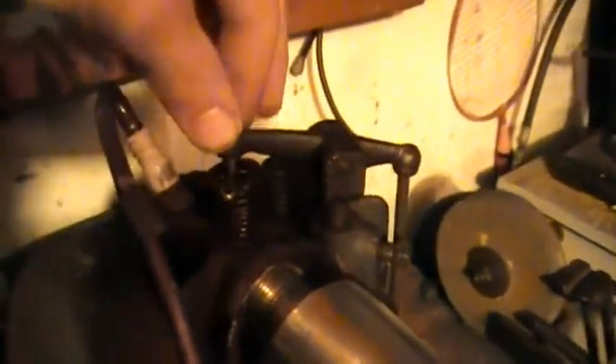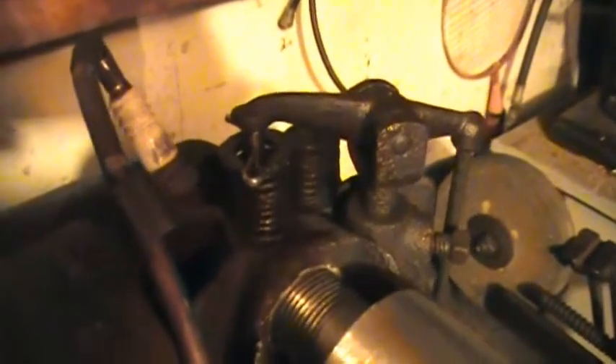So I'd rather the valve stuck than the piston. Anyway, the exhaust valve was a pain in the butt to get unstuck. I actually broke this — this valve came out of another Briggs 5S, I think, which works with the FH models. Anyway, the original valve is here. I broke the very tip of the keeper off there, because I have a little bit of a butcher's way, but I was trying to hammer it out of there after I soaked it for months, and heated it up and whatnot. I took it to my machine tool class and tried to grind another angle on there, but that didn't work either. Too much work in this little dome valve.